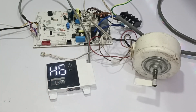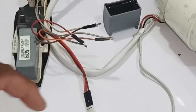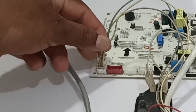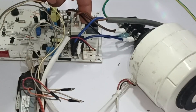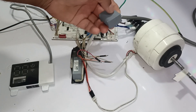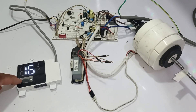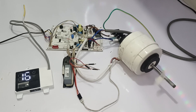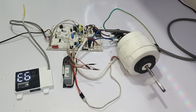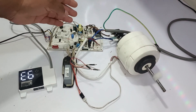I am showing you this so you can understand what I am saying. I will now check this bigger motor on this circuit board. The feedback connector of this motor was a little different, so I used jumper wires to connect these feedback wires. I have removed this capacitor from this circuit board because I am using this capacitor in its place. The blower motor shaft has started to rotate and it is rotating in the proper direction. The E6 error has started to display, which is the communication error, meaning this blower motor is compatible with this circuit board.